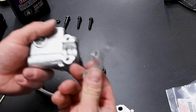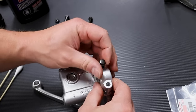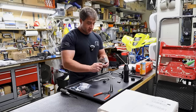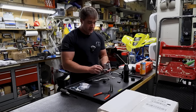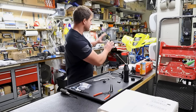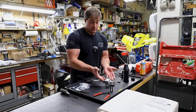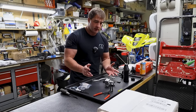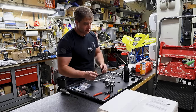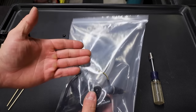This thing looks awesome. Fitting the clamp in the up position with original hardware, getting it threaded into place. Basically the whole idea of doing this here instead of on the machine is what I call pre-work - getting everything set so I can put it in a Ziploc bag, set it aside, and when it comes time to actually build the machine, everything falls into place quickly. I've already got the clutch perch bagged and tagged - you can see it in a clear bag.